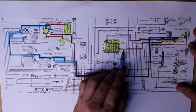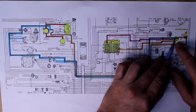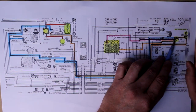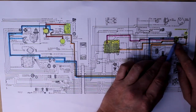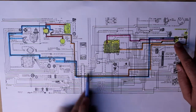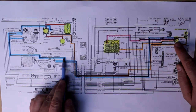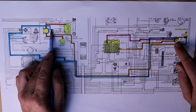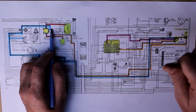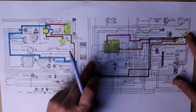Here's the fuse block — I've got a yellow wire coming off it, supplying power to the ignition switch. Position zero is where you can take the key out — nothing happens there. In position one, which is run or accessory, you put power down this blue wire I've highlighted. Tracing it out: it comes through the firewall connector, goes to the ignition box, and also goes around to the starter solenoid. Realistically that wire doesn't make sense to me — the starter solenoid shouldn't need run power, only start power.